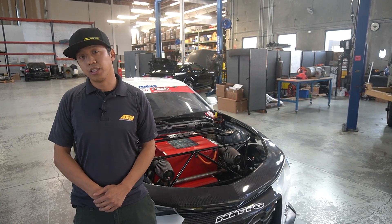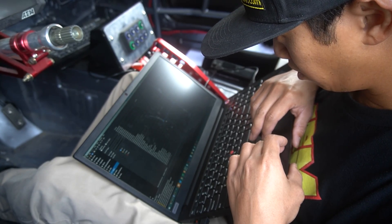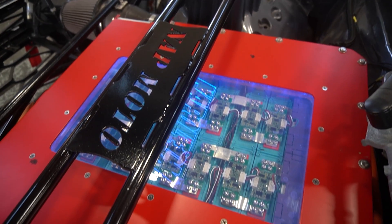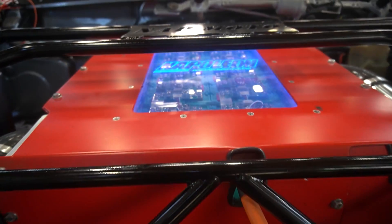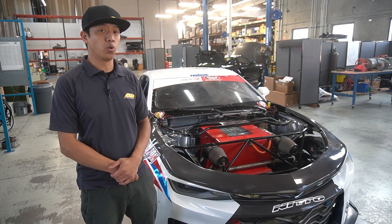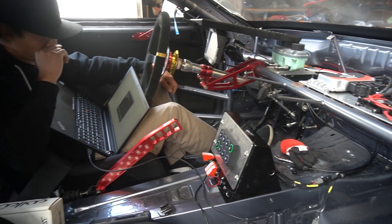As you can see, since the car is here at our facility, we've done a couple of updates to it. The heart of the whole system is the battery pack — it is a 1P 120S pack, 120 cells in series for a total maximum of 450 volts, though this car normally runs at about 400 to 405 volts.